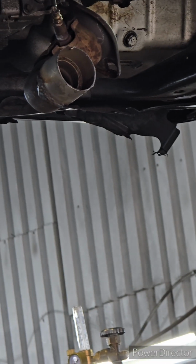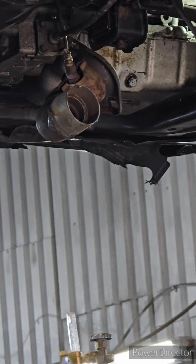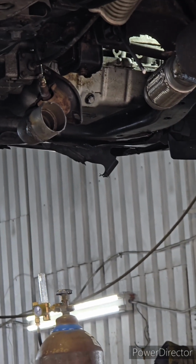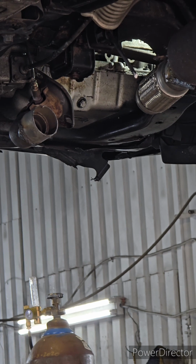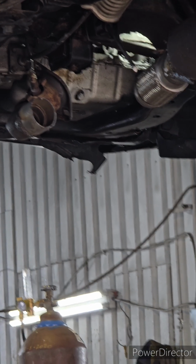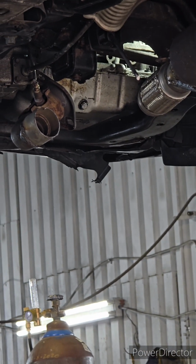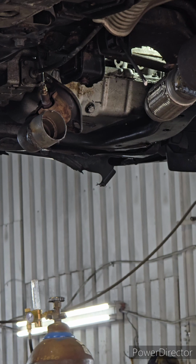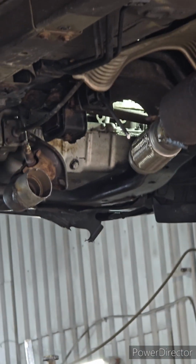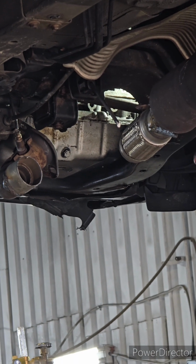The size of it can't be too big. It's leaking profusely loud. So hopefully they have a gasket that fits a little bit tighter, more snug. That's not cheap, because I heard these gaskets have an issue with off-brand ones. You have to get a Honda one. I'm hoping it's not a cracked exhaust manifold either, or a blown out gasket, but if it is, I mean, 140,000 miles, it happens, you know?